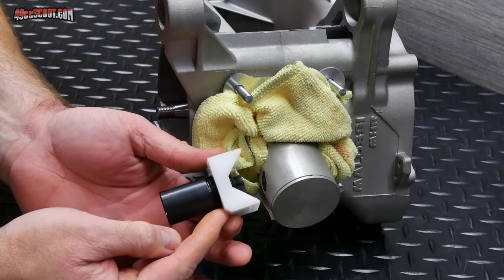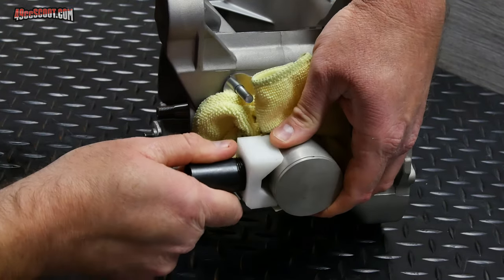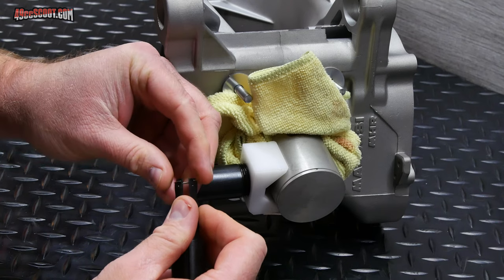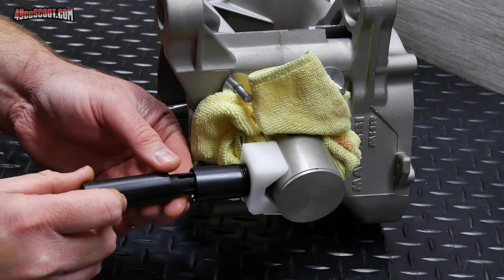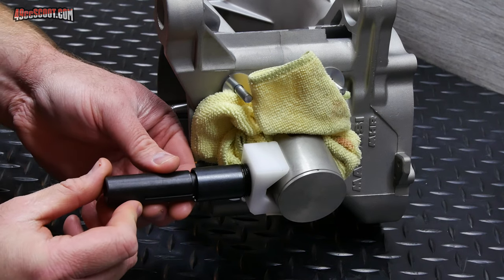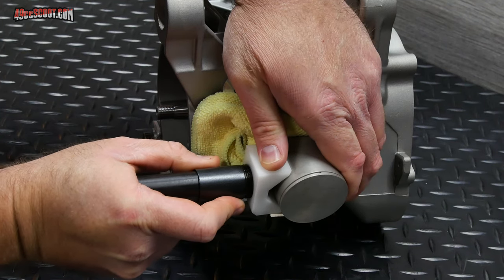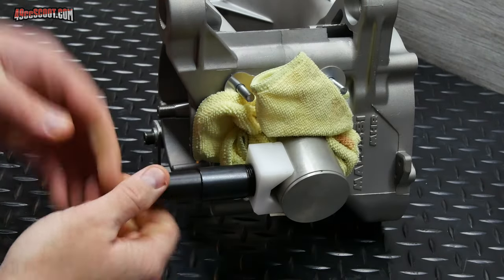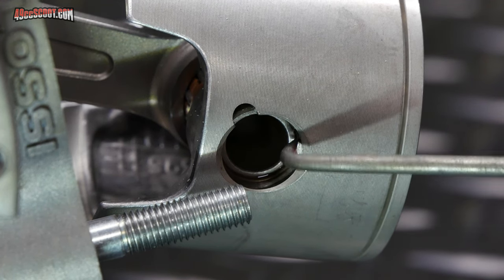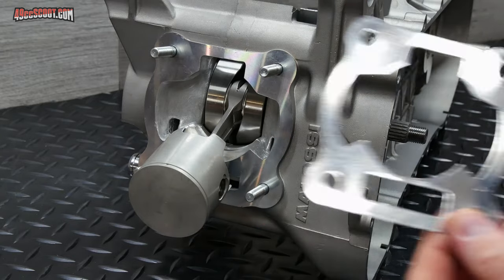So again, this angled edge is going to face the arrow, and I'm going to push this in all the way until this adapter stops it. Put my circlip on here with the opening by the groove with the dots in it. So I'm going to go ahead and start pushing this in, paying attention to where that line is. And I'm going to go ahead and push, and hopefully it'll click in place. Sounded good, so let's see what happened. And it did a good job again. Opening is right here at the top where I wanted it, and it's nicely installed in that groove without a scratch. You don't need to worry about the piston ring for a mock-up,